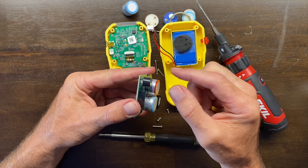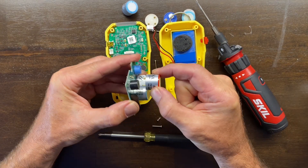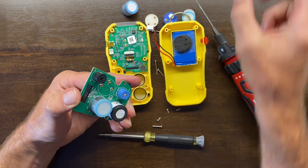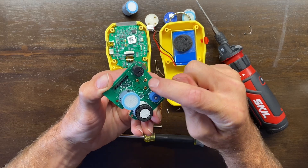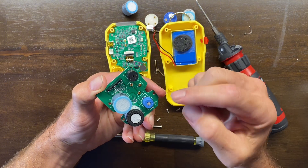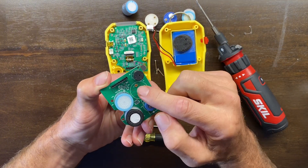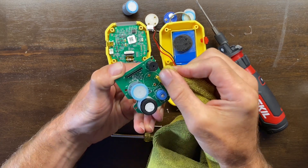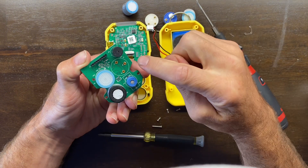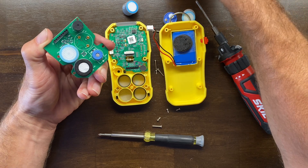Let's assume we want to replace our carbon monoxide sensor. Grab it with your index finger and thumb, start wiggling, and pull it out — it's as simple as that. Once you've pulled it out, I highly recommend visually inspecting the electrodes for corrosion or debris. If there is any gunk, get a cloth with some alcohol, dab it, and start wiping. Make sure the electrodes on both the sensor and the PCB are clean and ready.